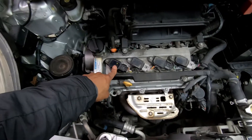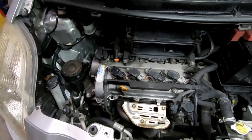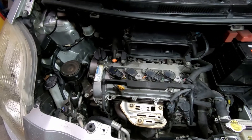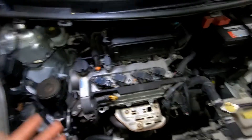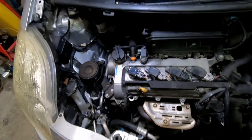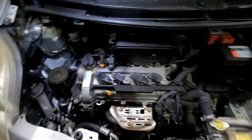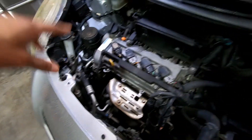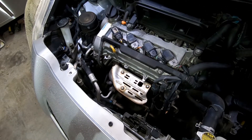We know this coil is bad. We'll pull out all the coils, pull out all the plugs, and investigate. By looking at the plugs it gives you a good indication of the condition of the engine — how it's running, whether it's lean, rich, or just right. I do recommend warming up the engine a little bit — it makes the plugs come out easier. Be careful especially if you have no history of the vehicle and you're not sure if the plugs have been removed, as you don't want to accidentally break them.